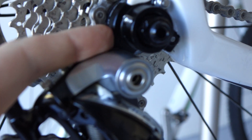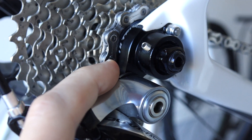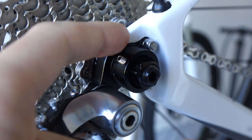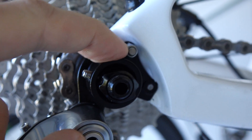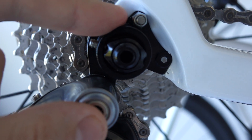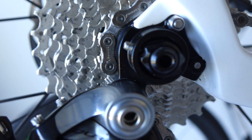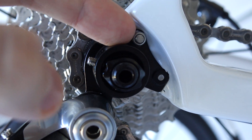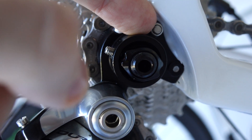But this design in general is very weird. Basically, this dropout — nothing holds it in place apart from those little tiny bolts. I was trying to fix it but obviously there's no thread. You can see how little aluminium is actually there, so you're not able to make an M5 thread and just go with a bigger bolt because there's not enough material on the side. What I had to do is put a nut — just take a longer bolt and put a nut through.